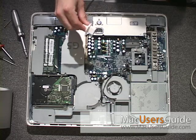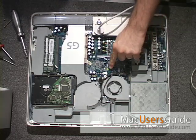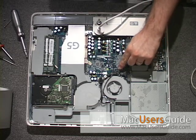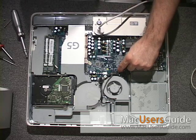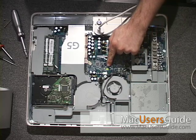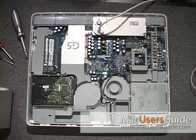Now you're ready to test what you've done. Plug it back in. You'll see a green light turn on, which means that you're getting power from the power supply. Push down the PMU to reset it. Then, hit the power button right next to it. You'll see two lights light up, the fans kick on, and then eventually the third and fourth light will illuminate.